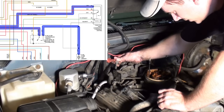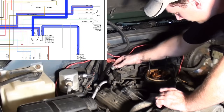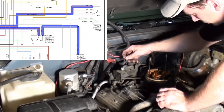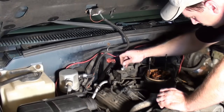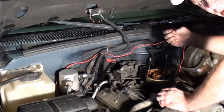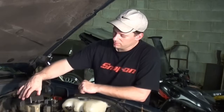Go back to the schematic. As you can see, it's the orange and the gray wire. The brown one is for your pressure gauge. Let's take and install the jumper and see if the pump kicks on. Fuel pump kicked on. So that's telling me that that oil pressure slash fuel pump switch isn't working correctly.